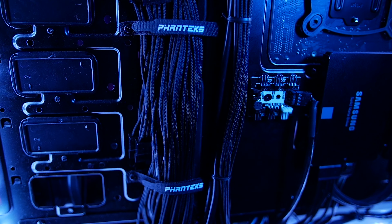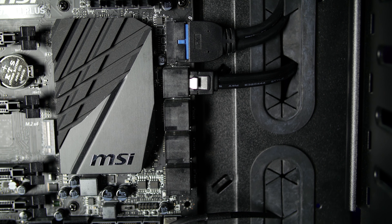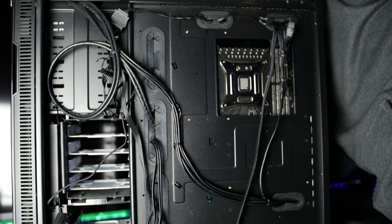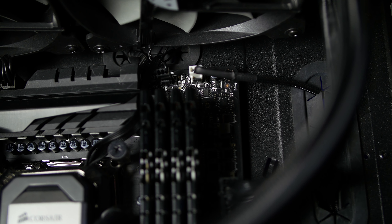Next up is the main chamber of your PC. Many newer cases make this super easy, either through grommets near power supplies and main access points on the motherboard, or with partitions that can hide an entire cable bundle — or both. On the flip side, some cases make this more difficult by putting clear panels everywhere. For the main compartment, your 24-pin and 8-pin cables usually don't show very much since they can be routed behind the motherboard tray, and the actual connection is typically close to those exit grommets. SATA data and power cables are often in similar situations, as well as front I/O and USB headers. The trickier ones tend to be the fans, usually because of fan header locations on the motherboard. Orient the fans so the cable is closest to an exit point on the motherboard tray — this helps with routing and allows more of the cable's length to be utilized.